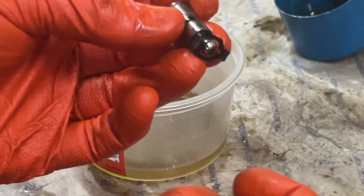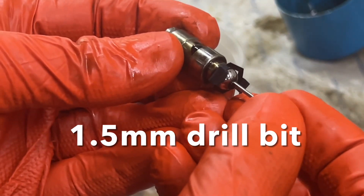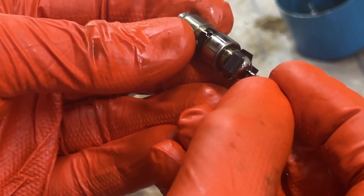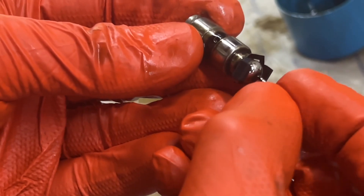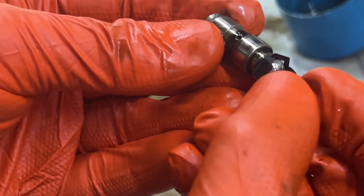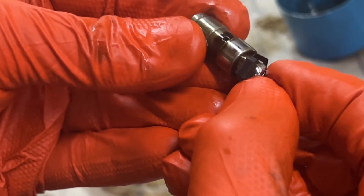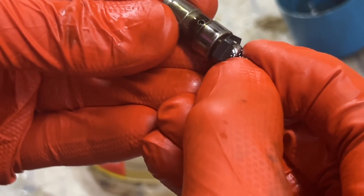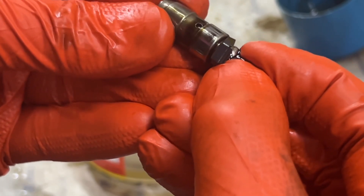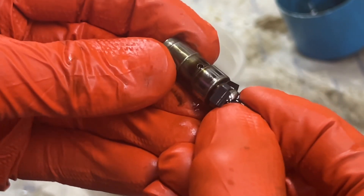What we're going to do here is get this 1.5mm drill bit and push it in - you can see I'm displacing some oil there. I'm going to go quite deep, then find the center, and find the point where it will depress just a little bit further, then release that. That's now opened up the internal valve which is right down the bottom, and it's allowed the oil to come out.